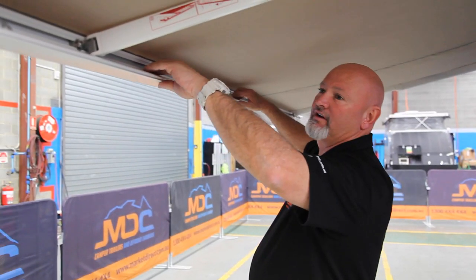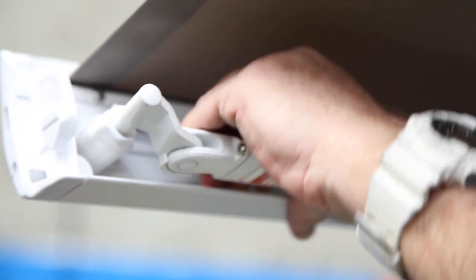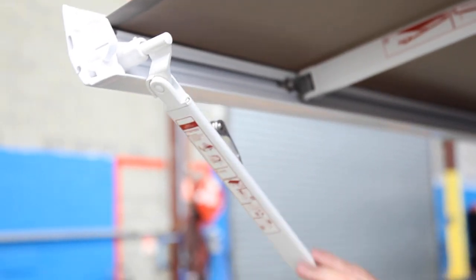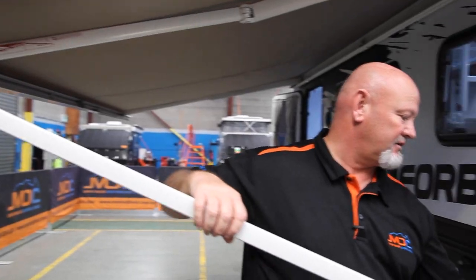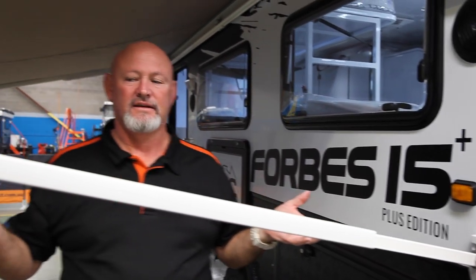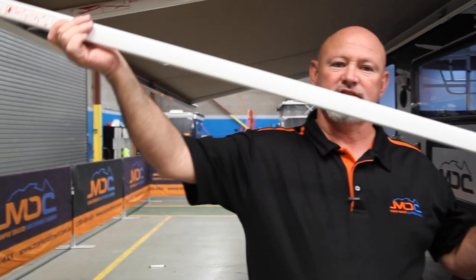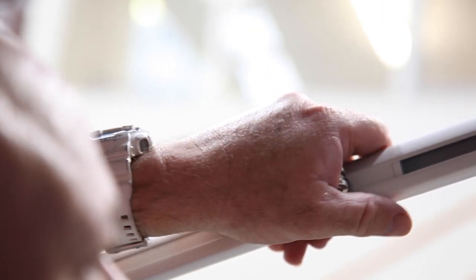The legs are in the awning fascia. Pop off one end, pop off the other, swing it directly down. As you swing it down, swap over hands so you're always on the inside of it. Undo it and slide it along. When you get the right distance, push up the top cap, put down the bottom, put that in, and it's locked into place. Have this free so this can move, so you can move it up, and once you get it to a point, lock it into place. You have two options: you can have it back at 45 degrees to the vent, or pop it straight down to the ground. With these pegs, you can peg it into the ground.